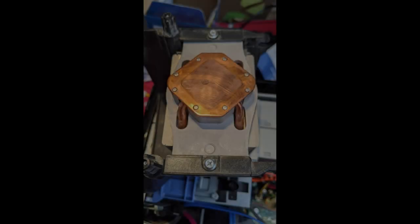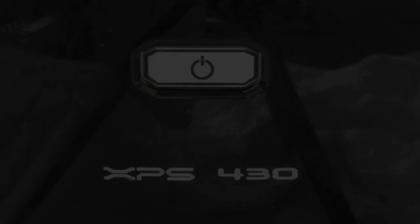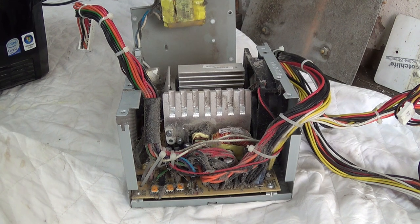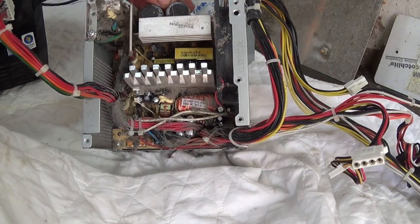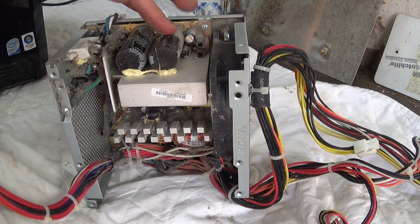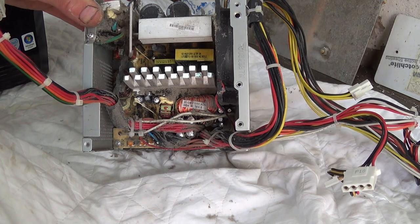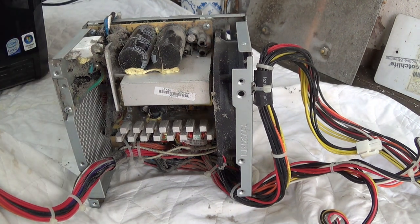Later that evening I got the thermal paste from my son, cleaned up the heat sink, and put the paste onto the top of the processor and assembled it all. Let's have a look at the old power supply — I've just taken the lid off it. It's absolutely covered in dust inside, as you might expect after 12 years. One of the usual suspects would be one of these power capacitors having gone soft — capacitors are often the main culprit of power supply failures. I don't have a way of testing them; I could buy them and replace them, but it's not worth the effort if I can get a replacement supply for £25.